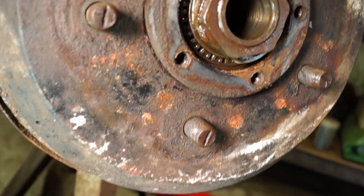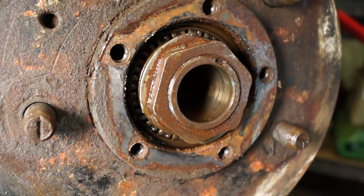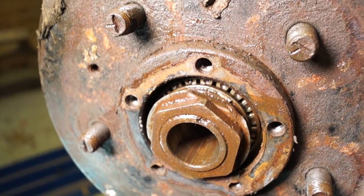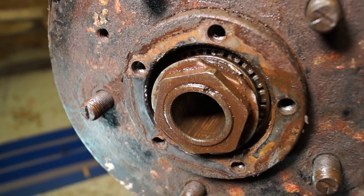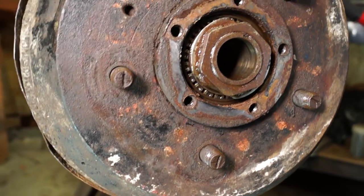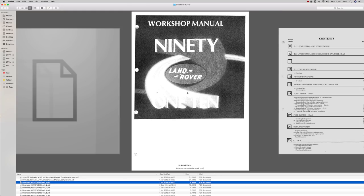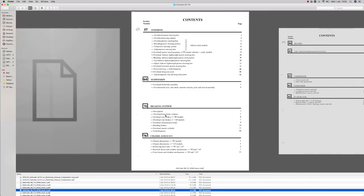I'll just show you this locking tab as well — this is quite amusing. It's bent the wrong way and you can see the top edge is bent inwards towards the adjuster nut. What the tab plate should do is actually bend around to lock the locking nut to stop it from shifting. However, if it's not tight enough it will come undone. When I look at things like that I'm very suspicious how much more has been put wrong.